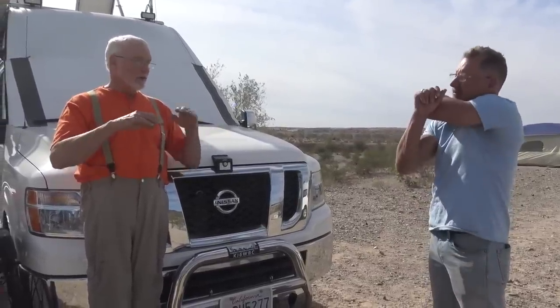It's set at 13.3 and 12.6 from the factory? It's 13.3 and 13. Oh, I thought you said 12.6. No, that's what the front battery is at night. Right, okay. So it turns on at 13.3, off at 13. So in the morning it waits until the back batteries get to 13.3, then it brings the front battery in. At night it waits until it gets down to 13 before it disconnects. So everything stays charged, everything stays happy.